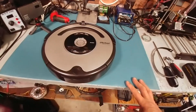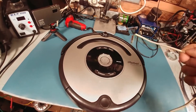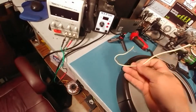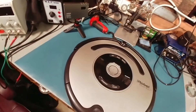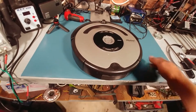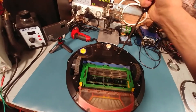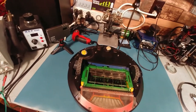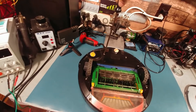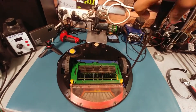Anyway, what I'm going to do with this video — here's the wire that I used to modify it. I used two fingers from my outlet, ripped it off, and that fits in the slot on the battery. Then I ran the wire around down the bottom and soldered the negative and positive on the tabs. It worked. It spun around for quite a while and the bin filled up twice from the basement alone. Basically the problem with the chemistry these vacuums use: if you let it sit for too long the battery will get memory and it won't hold a full charge anymore.